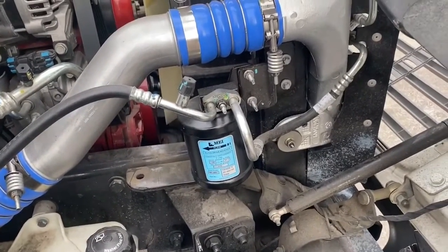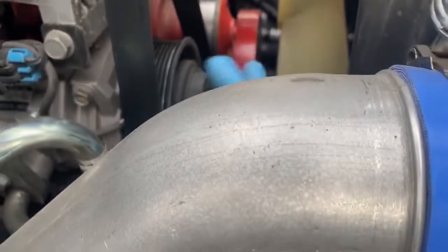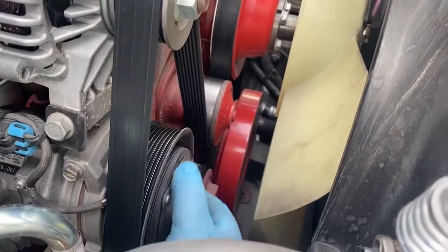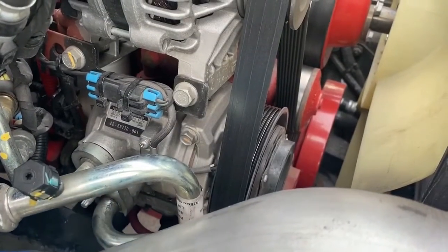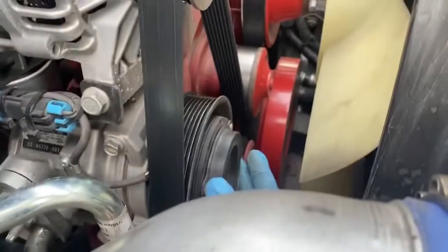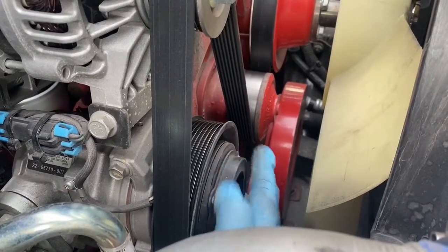So the first check you want to do when you're looking at everything is: first, as you can see, I've got a compressor here. On a compressor, this is the clutch. When this clutch activates, it clicks and it drives this pulley around, and in turn it has pistons and it starts compressing the Freon. So you need this clutch to engage. Basically, when you spin this around, you know the internal parts of this compressor are good — there's no seizing, it didn't lock up internally. That's why you're spinning this compressor.